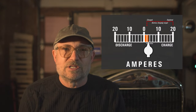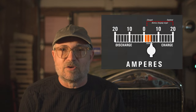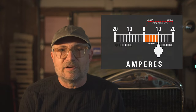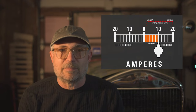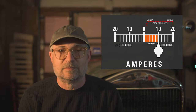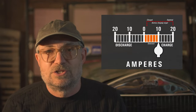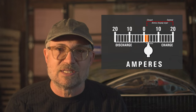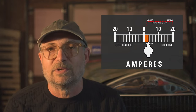The current to the lights is constant — it's either on or off. The generator current is variable with engine revs, but the set point of the generator is fixed for the chosen engine cruising speed. The trick is to choose a balance that yields a reasonably low charge rate in most situations and doesn't deplete the battery too quickly when you're driving slowly.